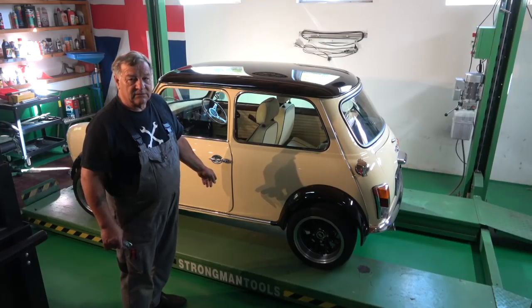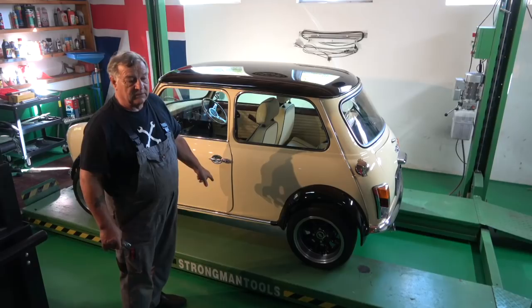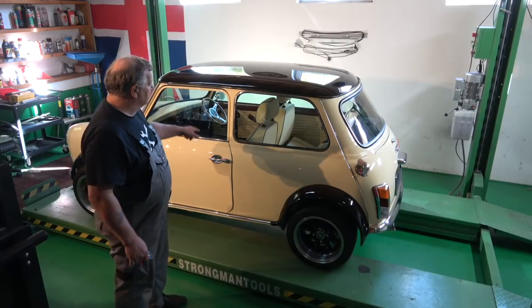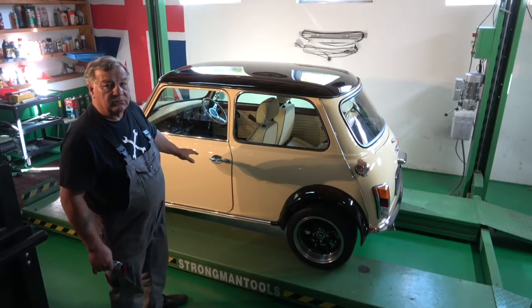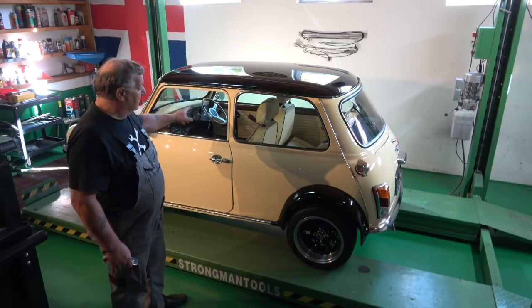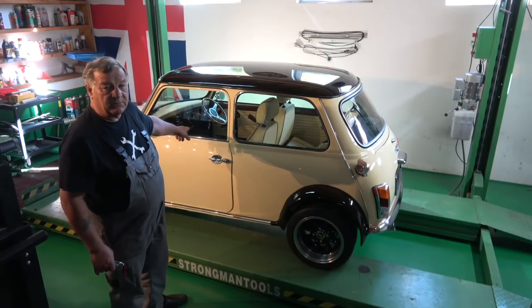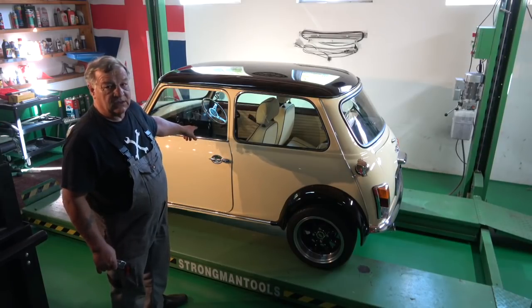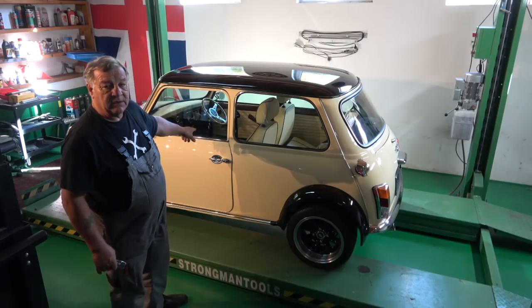So we're up against it to start with, but I want them over here, and I want them to look at it physically, and not through photographs. Come over here and see the damage that's been done. This pan on that side is reasonably easy, but it has to be repaired. But the one on the driver's side is very badly dished, as you can see from the first bit of video. And that's going to take a lot to get that back down without creases being in it.